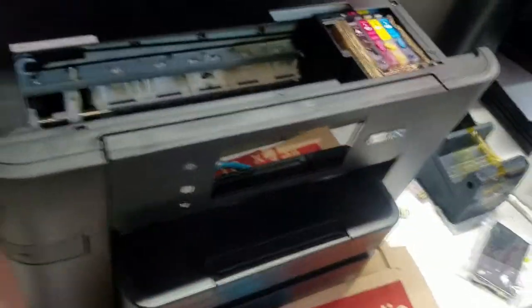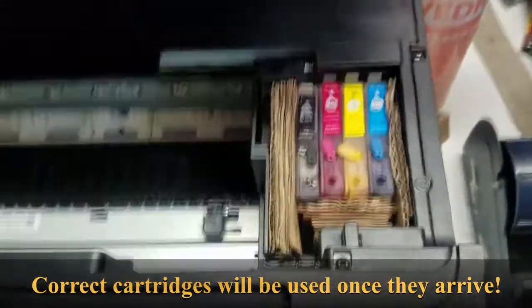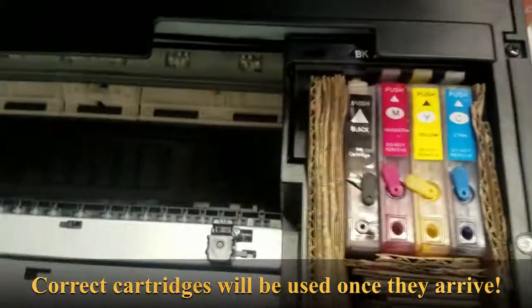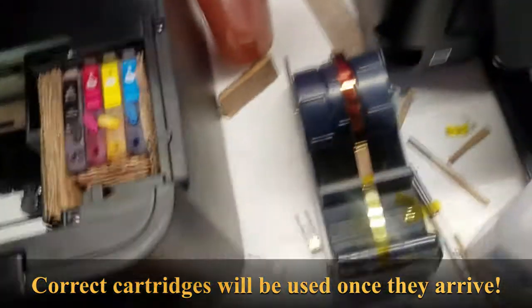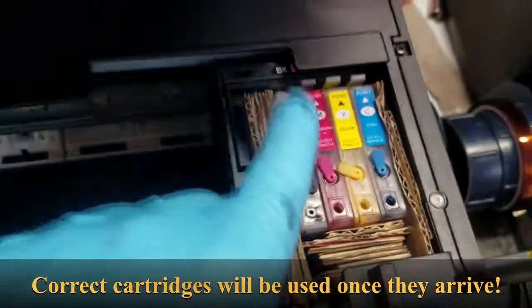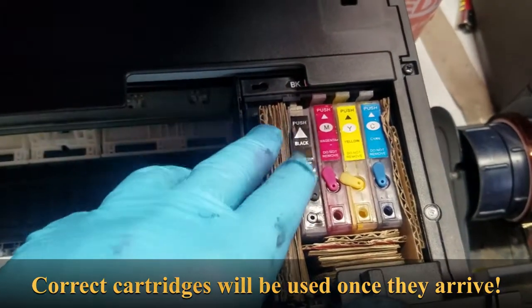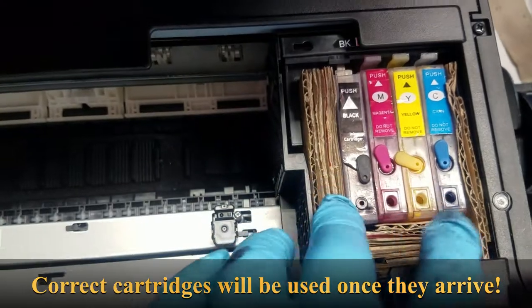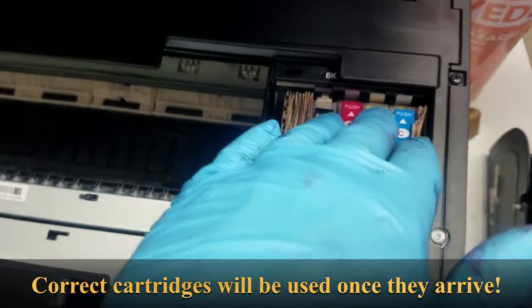Okay, so I got it to fit in there with my slim set, the cyan, magenta, and yellow cartridge, and I had a black cartridge from another set that didn't have that double cartridge like this one. It was just the single. So I got that one in here. I was able to get the cartridge over top of the nozzle so it can draw ink. I just had to use these cardboard shims that I made to put pressure on it to make sure that they don't move.